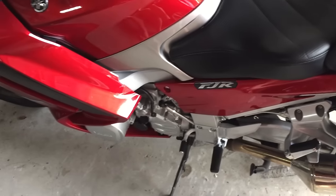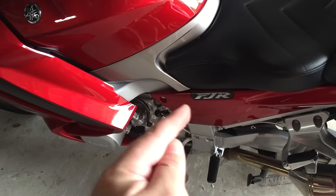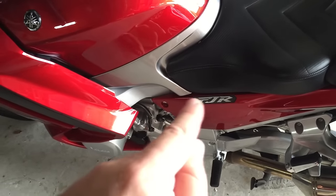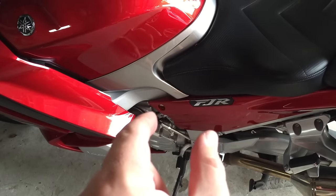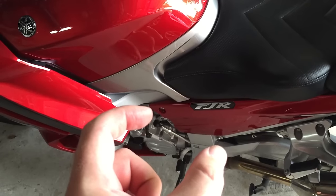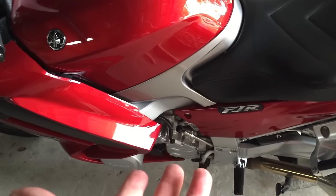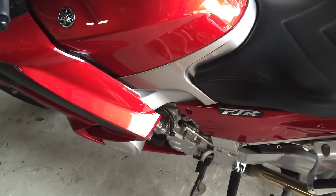So if you're like me and it's intermittent, give it a shot by just cleaning everything out really well — maybe it was just too much oil film in there. One thing I noticed: if you go back and watch the video you'll see the contact path for the pin that rotates in the engine and hits the pads isn't quite as much on the pad for first as it was for all the way through fifth. The rotation alignment just wasn't quite right between the part that moves in the engine and the electronics piece, so it didn't have as much contact on the first pad. It just needed that little bit of extra clean contact.